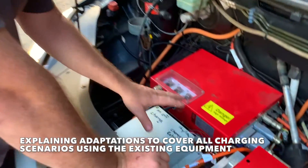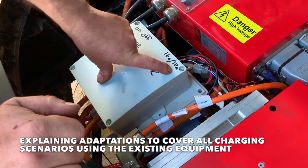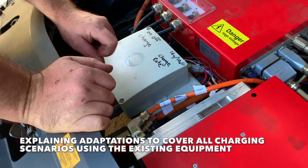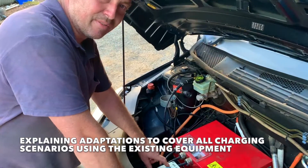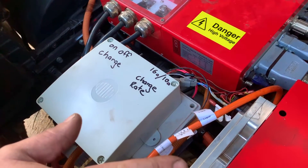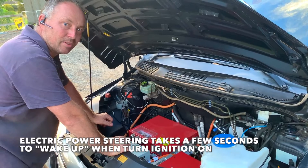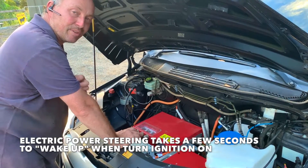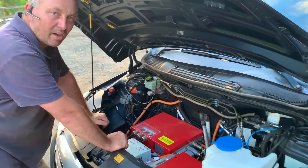We have two switches on the charge control box, which is full of Arduinos. There's an on/off charge switch and a charge rate selector: 16 amp for a 16 amp power point, 10 amp for a 10 amp power point. The charge switch must be on to charge and in the off position to drive. The electric power steering takes about four to five seconds to wake up and kick in — you can see the speedo move slightly while the CAN bus is talking, and when it stops the steering will work.